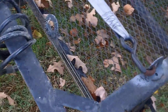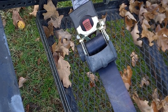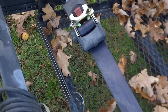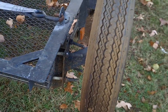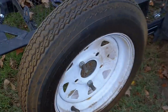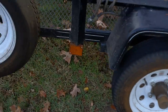I use locks whenever I put the four-wheeler on there — I can use a combination lock and lock it down. The straps I use are this style; I use two and they're rated for 2,500 pounds each, so more than adequate. I always put a spare tire on — I bought a kit at Harbor Freight and mounted it to the front to get my weight forward. I bought a trailer tire the same size as the one that's already on there.